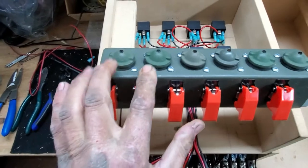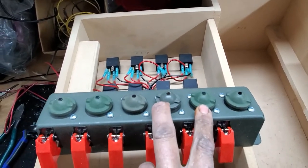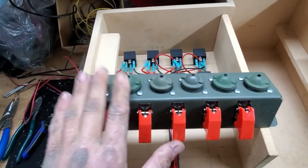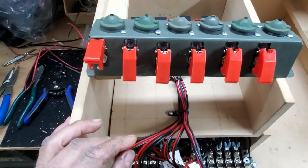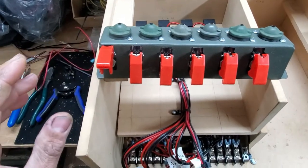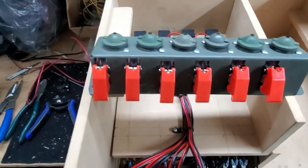I decided to break out the front in blue — blue represents the front. I have an orange one for the convoy light, green for the cargo lights one and two, and then red for the backup light. That way I can visually see what it is, as well as it actually being lit. I decided to do the racing-style switches — always wanted to put that in a car or truck. Now is the time. What's really nice about these is when you flip them on they're on, but all you have to do to turn them off is flip it down — it's spring-loaded and automatically turns off.